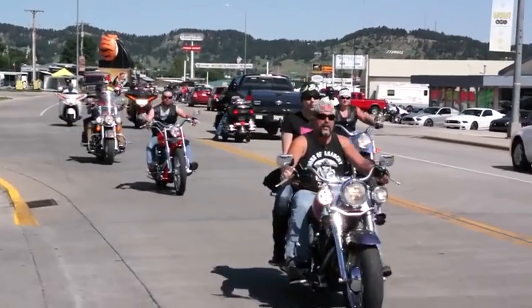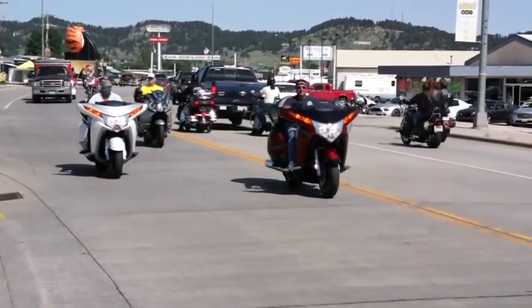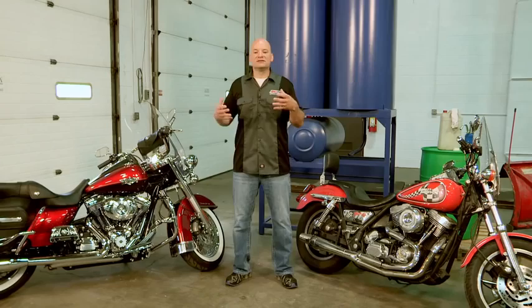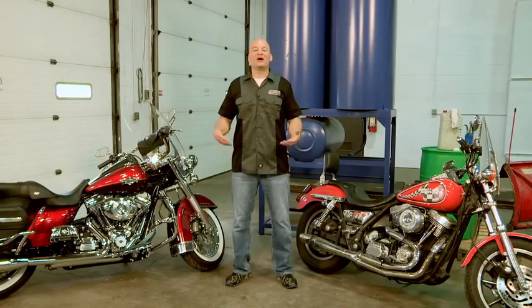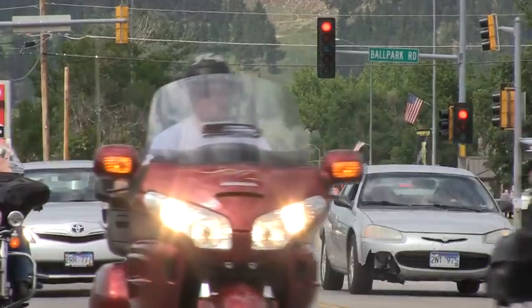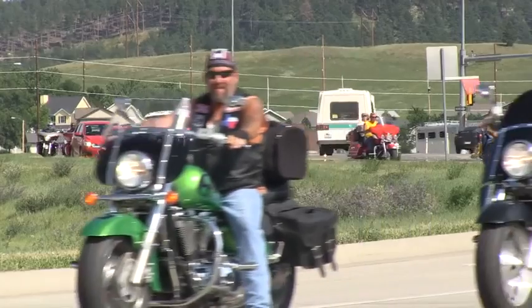Let's say we look at the bike itself. A large bagger can have fairings, it can have guards, it can have different covers on it that are going to keep the bike from cooling itself. The outside temperature can have a direct relation to the temperature of that motor. So the environment, the bike itself, the situation that we're putting it in can all have an effect on heat.